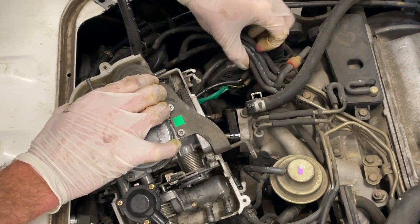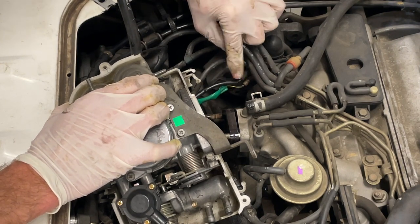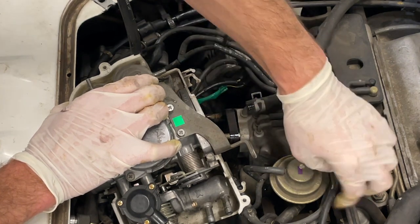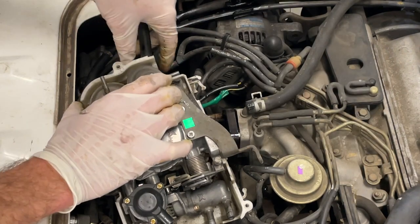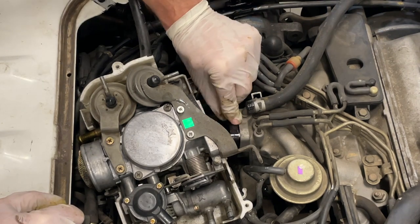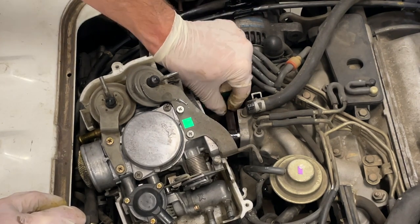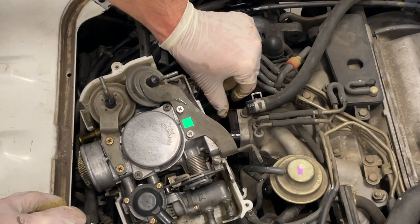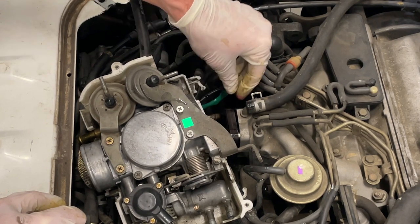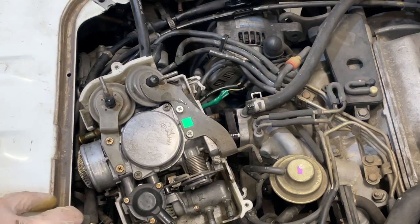these two connectors here are what go to your solenoids that we're actually going to be replacing. So we'll knock those two loose, those two hoses, that one T, extract our carburetor at that point, bring your little flange out here. This is going to have O-rings in it. Let's take care of those. I'm not sure if the kit has those or not. I would hope it does, but be sure not to lose that.